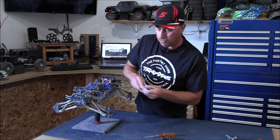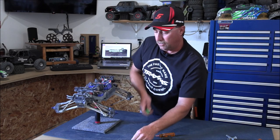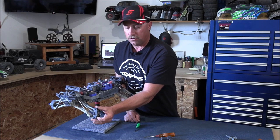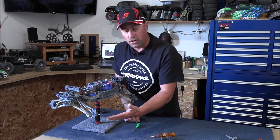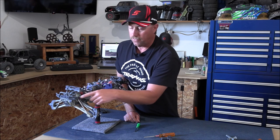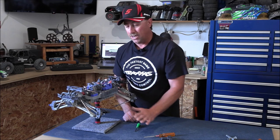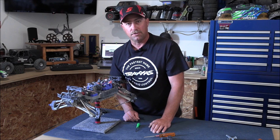After you do that, the pin that's in here just pushes right out. See that? Then you can go ahead and pull your hub off. So now when I take these two Allens out to remove your steering knuckle from the control arms, the axle will just slide right out as well. I'm going to loosen all those up and disconnect this push rod from our suspension system, and then we'll show you how to get the control arms off and inspect the pins.